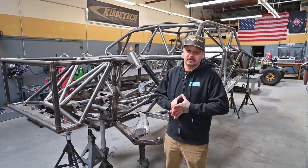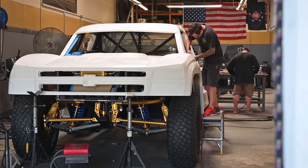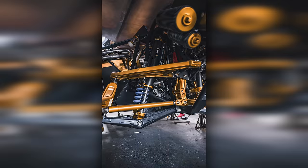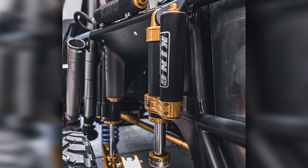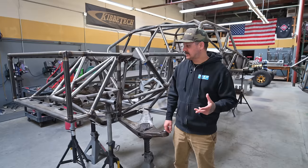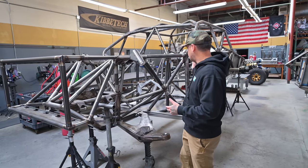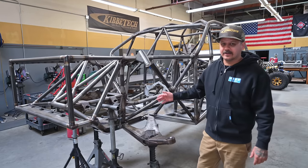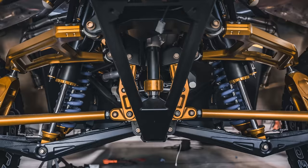Another truck we haven't talked about on our YouTube channel is the trophy truck build. We built a trophy truck — standard 93-inch track width, 125-inch wheelbase, big block Chevy from Danzio, 975 horsepower, Turbo 400, Tube Works underdrive, full King Shocks package, custom 30-by-6 bypass external reservoir, rear bump stops. We're the only ones besides Concrete Motorsports that have those — thanks to Brett at King for letting us run those. We didn't film too much of that throughout the process, but it's basically similar to the gray tundra tube chassis truck over there. We'll show you some stuff and talk about the similarities to the race truck.